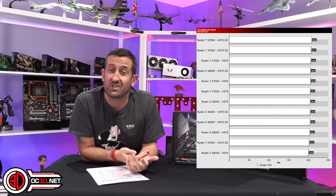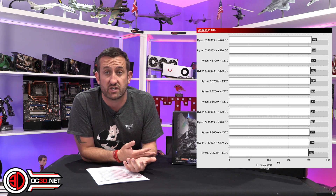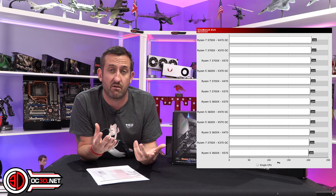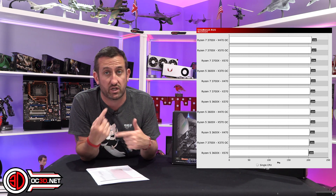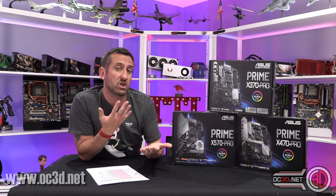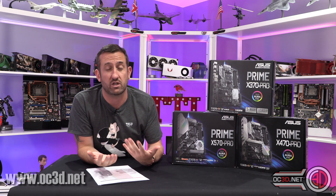The only reason I use the Asus board is I had a full set. A lot of you think that when stuff turns up it just stays, but a lot of the manufacturers do actually rotate the samples, so this is one of the few options I actually had. I did have a few other Asus options, but I stuck with the low-end one — I went with a Prime — so that we could go for a worst-case scenario. If you've got a slightly higher-end board, you're probably not going to run into some of the issues with VRMs and the like.